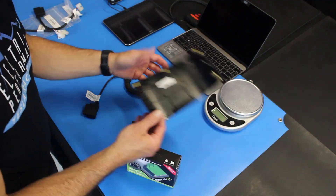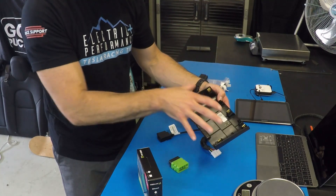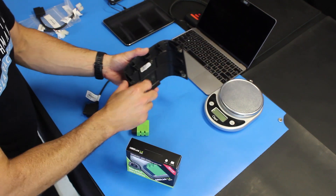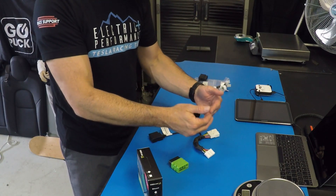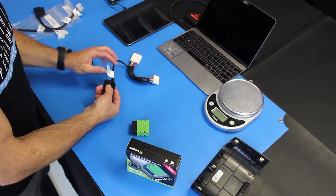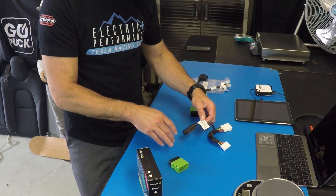In the center armrest towards the rear there is a panel I'll show you in a few minutes. This is the black plastic trim piece that gets removed. There are multiple retention clips that go behind that center armrest. Once you're there, we'll get access to the standard harness with connectors and interrupt that signal by placing this adapter there. The part number will be in the description — we sourced it from a local place in Florida and they're very reasonable in cost for the amount of data you get.